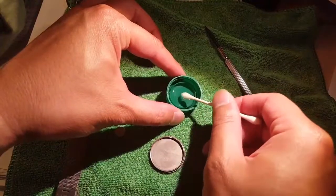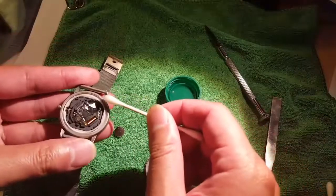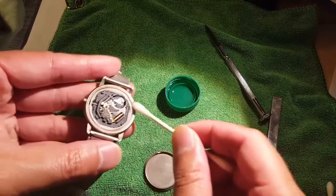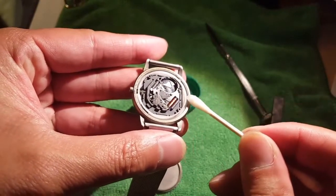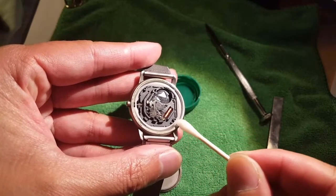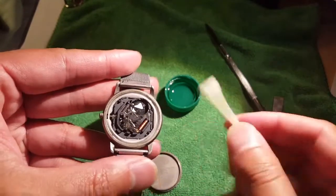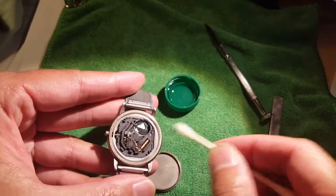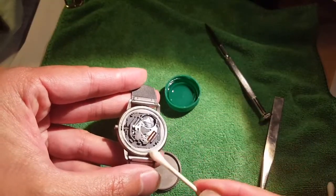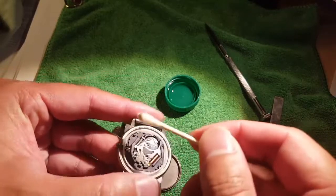What I do now is a cleaning. I get some rubbing alcohol — 50% rubbing alcohol. You can use whatever you want, but I basically put a little alcohol on a Q-tip and dab it along the edges where the metal contacts are. I try to soak any old skin oils or human oils — all that dirt — with just a little bit of alcohol. Be very careful not to drench it; it should just be moist so it doesn't flood the watch. That's a scary thing.